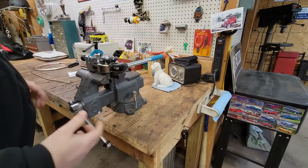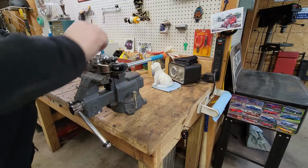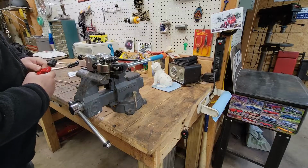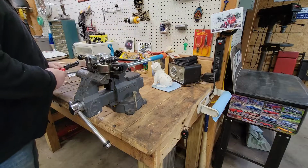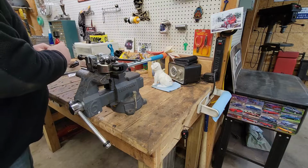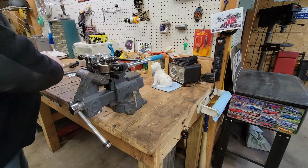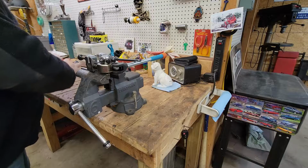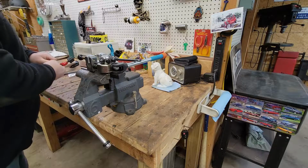It's that easy to put together, right? This thing is awesome, I'll tell you that right now. So, we got our line over here. Not flaring the hose. Deburr it. This is the biggest thing for this tool, they say you gotta deburr it. Any little extra metal in there, it's not good.